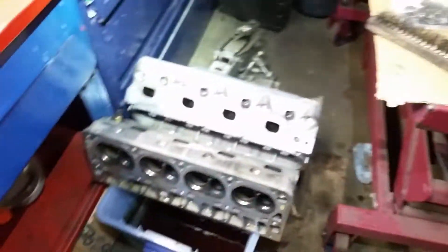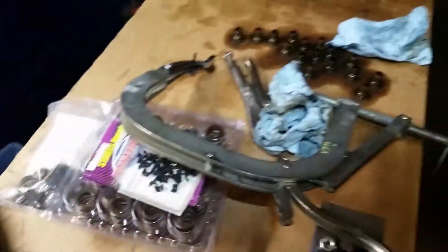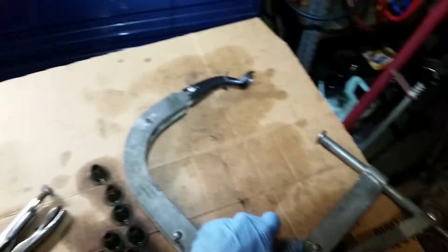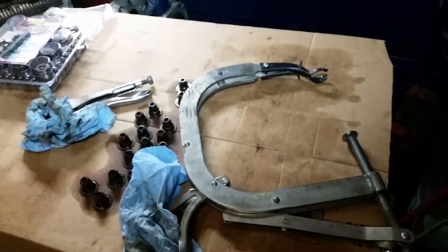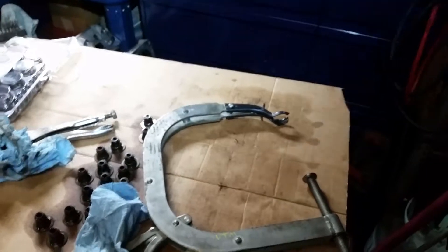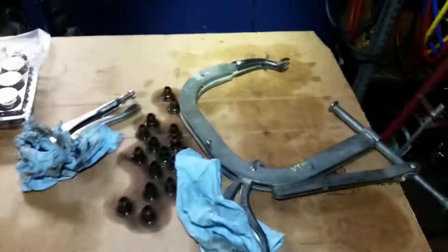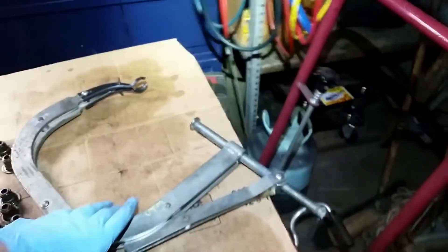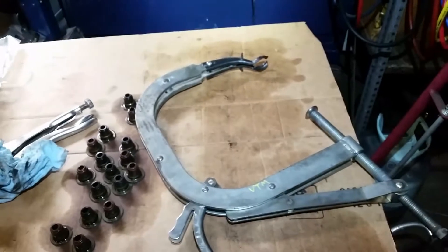These are the heads that are going on this guy right here — just cleaned them up, got the valves out of them. I'm going to put these high valve springs in them. Using this tool for like the first time in a couple years; usually I'm doing these on the car. He wanted to change the lifters for stock lifters — I don't get it, I would have put some roller rockers in — but since I got the heads off, figured I might as well break out the old dusty valve spring tool.